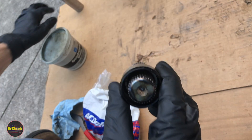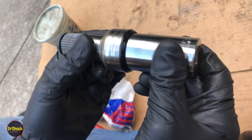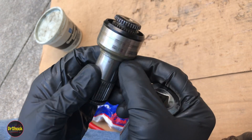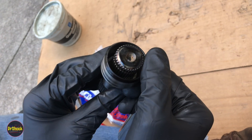First we're going to figure out the correct position of this sleeve on this shaft, because we're not going to use a lot of the fancy expensive tools that GM has in the service manual. We're going to use a couple of them and I'll show you their measurements in case you want to fabricate something. A lot of their tools are meant for changing these parts while it's already mounted in the car. Since we've got it out, we can improvise. Mostly I'm going to use a press and a 1 and 1/16 inch socket to push the sleeve on and the bearing press to pull it off.